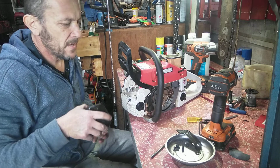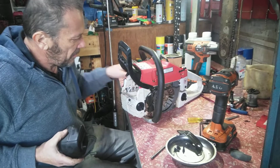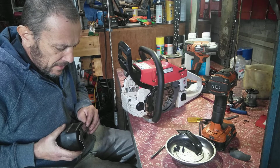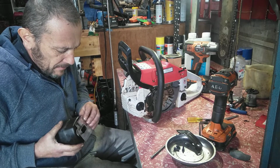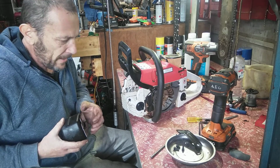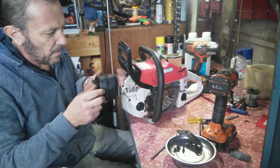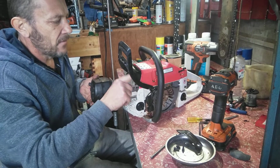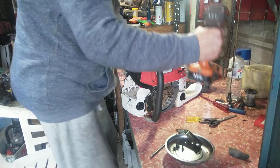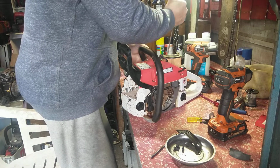Now, I won't be trying to be as smart, but normally what you do is you push your bolts through, pull them like that, put your aluminium deflector on here. That's to keep the heat in the right spot so the fan can blow across here and keep the motor cool. So you got to put that back in. Now, if I had time off camera, I'd just put it on, but I don't think I could. So I'll take that cover off. We'll do it the proper way, so we don't cross-thread crap. Get the screwdriver. It's got to come off anyway.